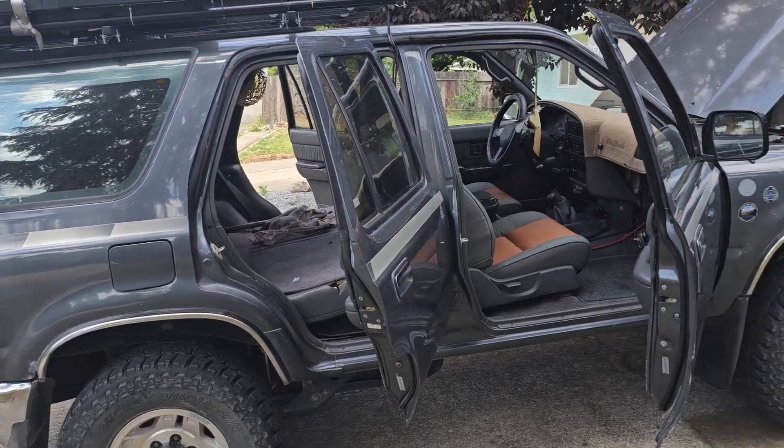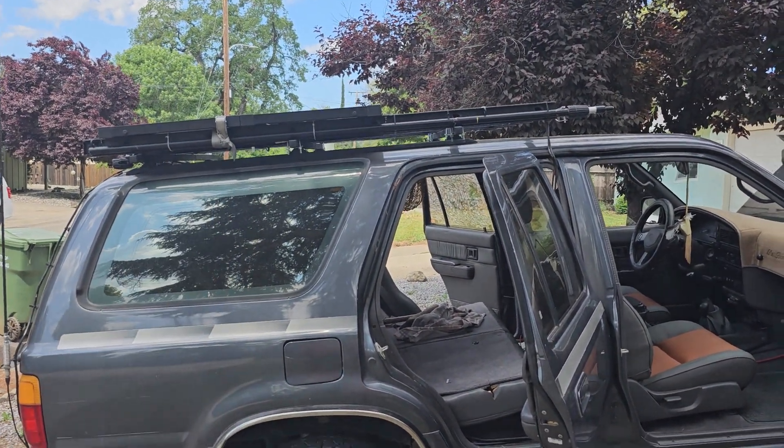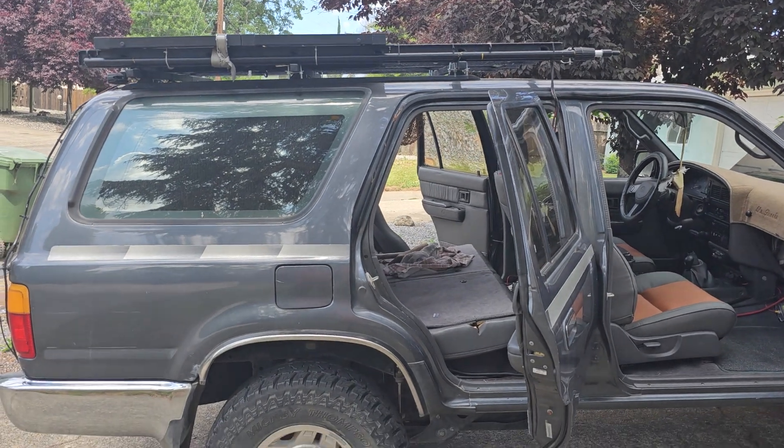After about three days it would get tough, so I went with the DC-DC converter so it'll charge from the alternator while I'm driving and from the solar when I'm parked. I talked about Redarc and that kind of thing — it's great — but I'm not driving through the Andes or the outback in Australia. The Renogy suited my purposes, saved me some money, and that afforded me more money to go with the lithium-ion battery too.